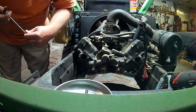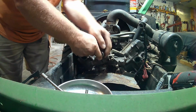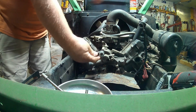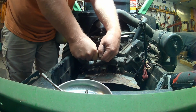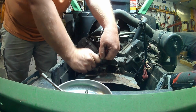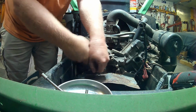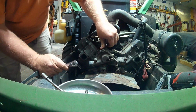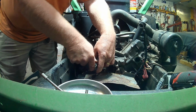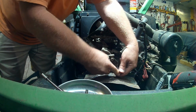And let's get the actual water pump off there. Oh, don't break. Oh, don't break. I'm going to be easy and gentle with it. There it comes. Ooh, these things feel scary, like they would really love to break. Tell you what I'm going to do: as I break them loose, I'm going to tighten them back up. That'll take a little bit of strain off the next bolt that I come to.